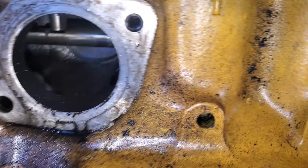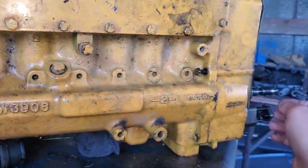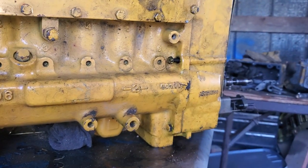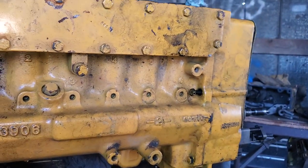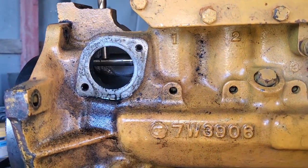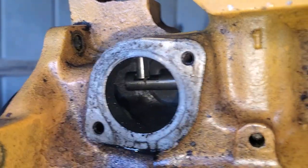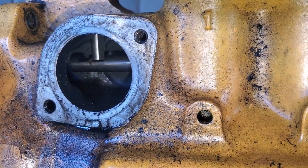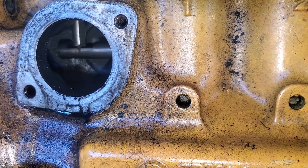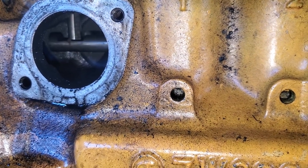The first thing is you want to take that cylinder off the back of the housing, or what I did is I just turned the key on so that way you could move the rack. I took this cover off and you can see the rack — that's the rack that turns the plungers. When you move the throttle, that's what moves.